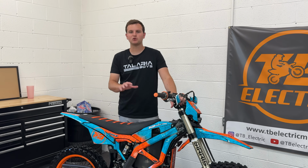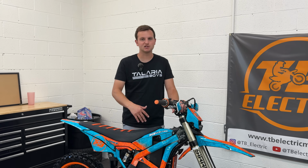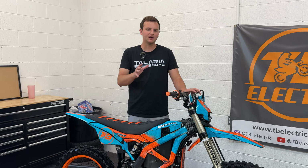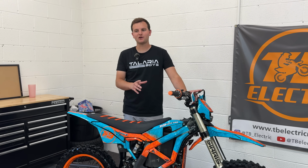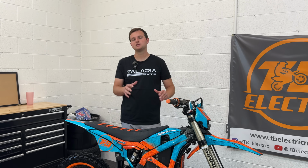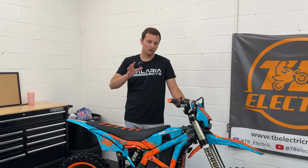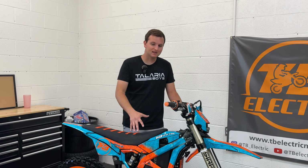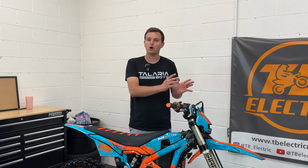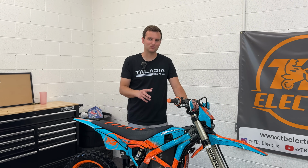Then basically, if you climb any kind of steep stuff, you will be overheating your motor super easily unless you upgrade your motor too. So it's kind of a slippery slope with the Ultra Bee. If you do a controller, you're gonna wanna do a battery, but a battery is $3,800 for this one, so it's extremely expensive, so it is hard to justify unless oftentimes you're doing these 40 to 50 mile rides where you really want this kind of range. So that is why we did the whole combo, is because the controller didn't provide as much power as we wanted and our motor was still overheating. So once we got the battery, we had to do the motor, and now the combo is working really nicely.